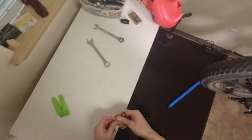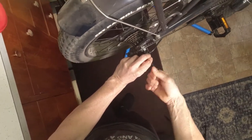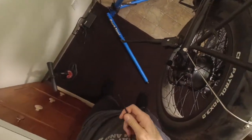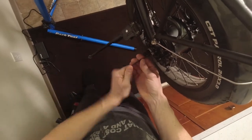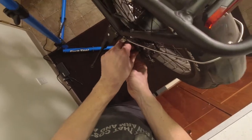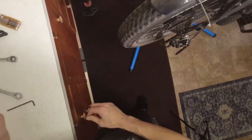The first thing you're going to want to do is take your four millimeter and unscrew this little bolt right in here, and just go ahead and take that right out. Now go around to the other side — there's another one. Take that one out too. These are little extra safety bolts; this one helps bolt in this little cage because these derailleurs are kind of cheap and easy to bend and break.